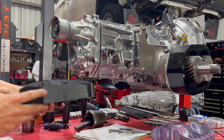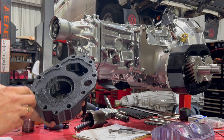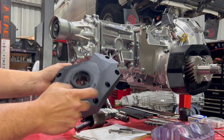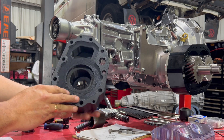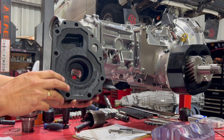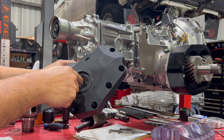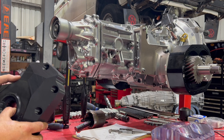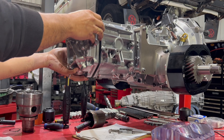I received quite a few questions about the Synchro Kit. I could have gone into more depth in the last update but didn't want to make the video too long. This is the 3D printed prototype — this is basically going to be the cover plate we make, with some changes. You can see there's a really deep borehole for a double row angular contact bearing, so there's a lot of support at the end. This will take a seal — 50mm OD, 35mm ID — which is the same as the stub axles on the front differential of a Subaru 5MT.